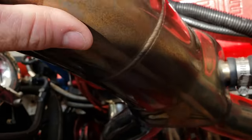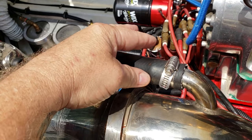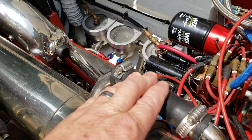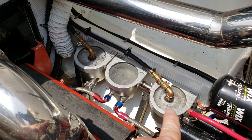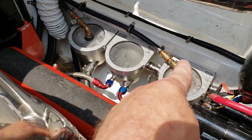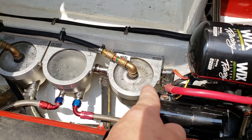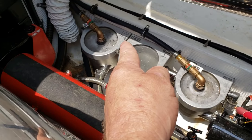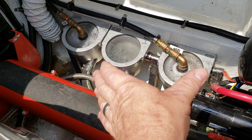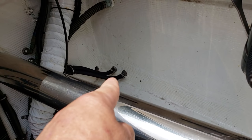That's why this is getting hot. Out on the water when you're running for more than two or three minutes at 85 or 90 miles an hour, the engines are spun up pretty high and this starts to melt and blows open — that's why the boat steamed up last time. So we went ahead and put sea strainer relief valves here. Alan from Lily Sport Boats put in check valves — those little bands — that only let the water and air go out one way. This is the port motor's sea strainer, that's the starboard motor's sea strainer.